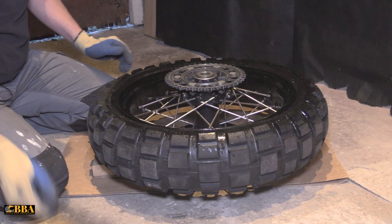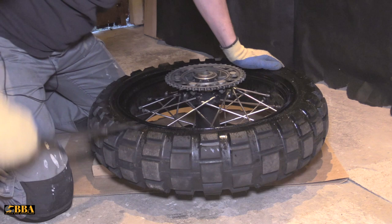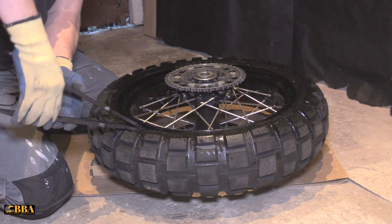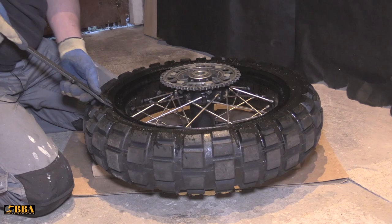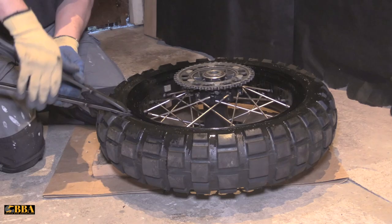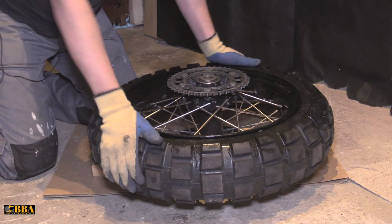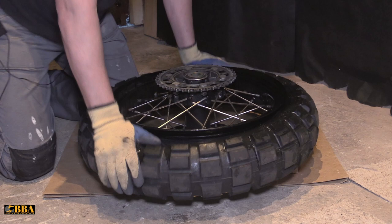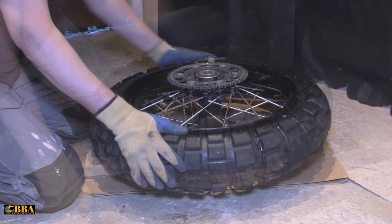You don't need to be too gentle. Hold one side of the tire with your opposite hand, push the bar in under the rim, put your bead breaker on top, clamp them together and push down. Turn around a little and do the same thing again, and keep doing that until the bead has popped off the wheel all the way around. Once the first bead is broken, push that bead off all the way around — once it comes off it's fairly straightforward. Flip it over and do exactly the same thing on the other side.